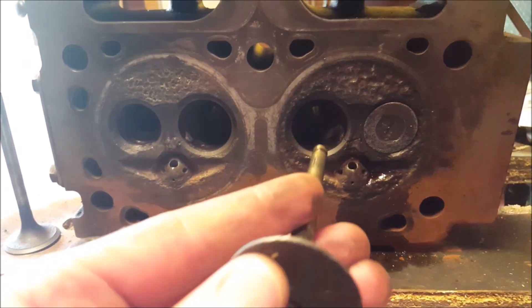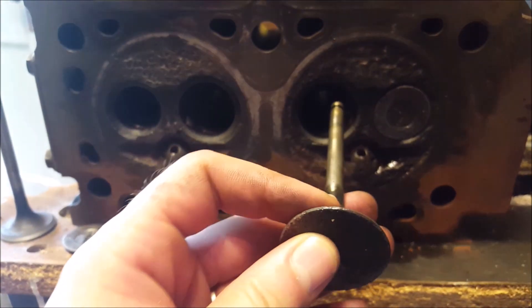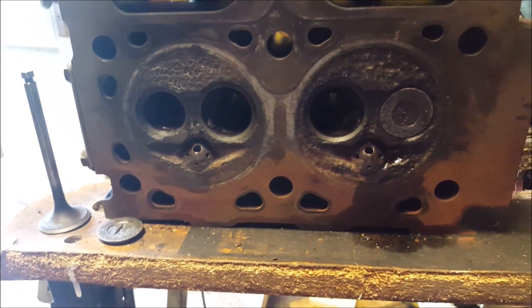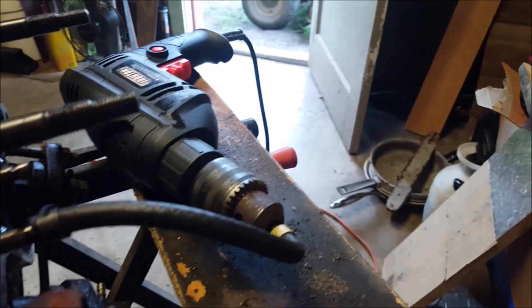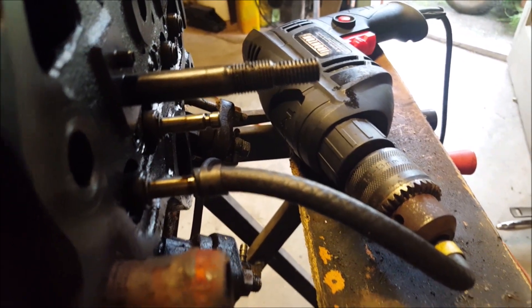You have to be careful — you don't want to go too deep, because it basically causes your valve to sit further back. You're removing material here and removing material here, so your valve ends up going back further in just a hair, which makes it stick out the back a little more and makes the spring a little bit weaker — the spring and keeper that hold this in on the back side. So instead of sitting right here, it sits like that.